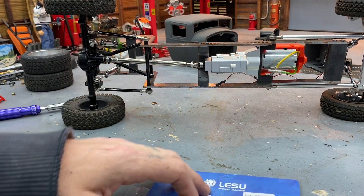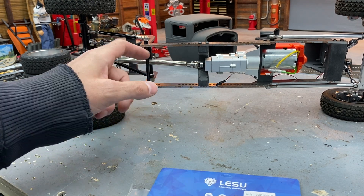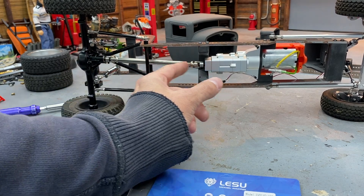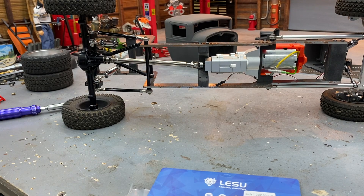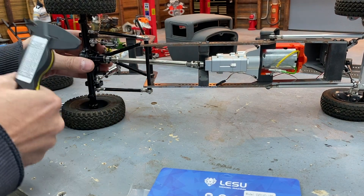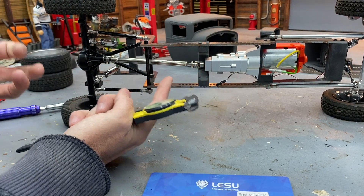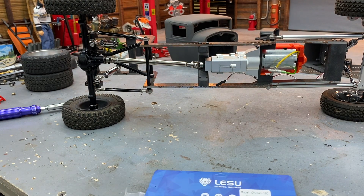I had another one — I think it was 130 to 160 — and while it would technically work, it had too much of the inner slip shaft showing and caused a lot of vibration. When measuring your driveshaft, lean towards the longer size within your range. If you have a lot of articulation, measure it fully compressed and fully decompressed. This driveshaft was about $23 plus shipping from Semi Joe — it's a gorgeous piece and I've never had one fail.